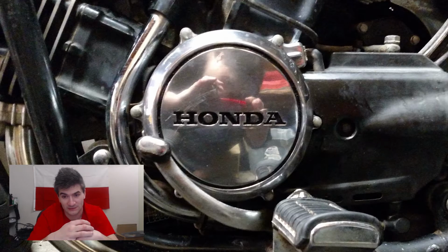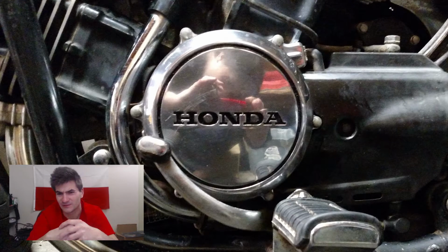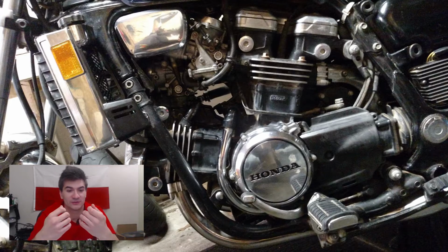Well, what I tend to do on these bikes, and I did it on my first Magna back in Poland, is use paint stripper to take the clear coat out completely. Be careful, don't touch it. I prefer to use aircraft brand stripper, because it's probably the most potent stuff you can get. I'm not absolutely sure. I'm not sponsored by anyone, I'm just saying. I use that one with a lot of success. Just be careful, because if it gets on your skin, it burns a lot. Whenever you work with bikes, try not to put your fingers in the chemical itself.